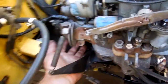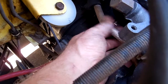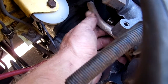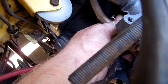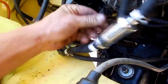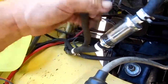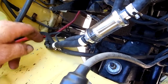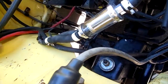So that's pretty much it. We got this pipe fitting here — try to loosen that before you take off the intake manifold; try to break it loose and make sure you pre-lubricate. If you do it while it's connected it's easier to turn because the other object is not spinning and you'd have to hold both of them. If you have one of these glass filters in there, make sure they're not banging on anything. I got mine nice and tight and that's why it won't hit nothing. But they break if they hit something, and then your gas just keeps pumping and you start a fire — so just a safety thing.